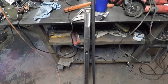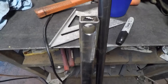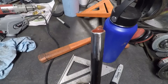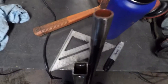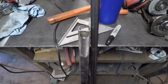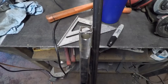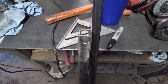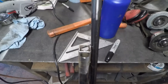I've got the rear bar for the seat supports all measured out and drilled — about a one-inch hole. I'm going to take a one-inch piece of tubing, eighth-inch wall, cut it down to an inch and a half, weld it in place and grind it down — that'll keep it from squishing. And then we'll use some grade bolts to hold those down. It's raining pretty good out here today so I can't use my cutoff saw outside — I'll do that tomorrow morning.